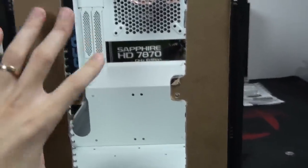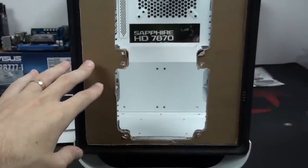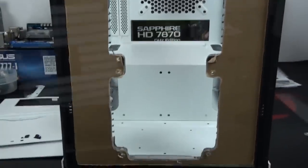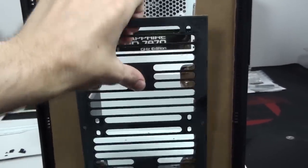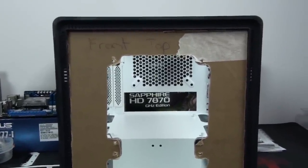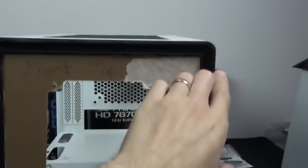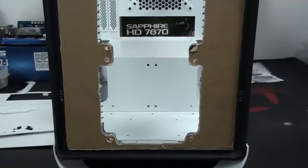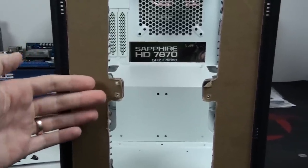The plexi panel fits very tightly into that outer black strip, and that's because I managed to get those cuts very straight, which I was really happy about. I've cut out the ventilation hole in the middle of the plexi, so all you'll be able to see in the middle is the radiator grill and then behind it, the radiator. The mounting bolts go through the radiator grill, then the plexi, then the case panel, and into the radiator — so it's all held together very strongly.